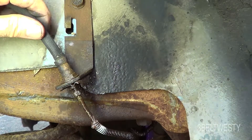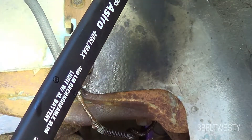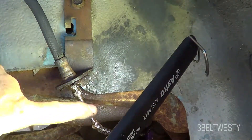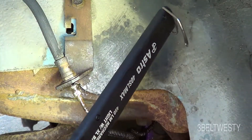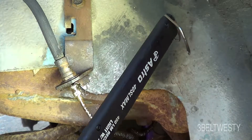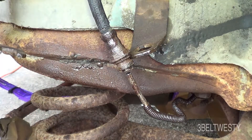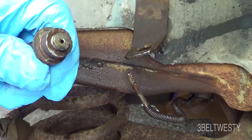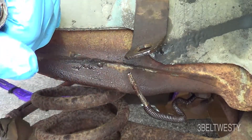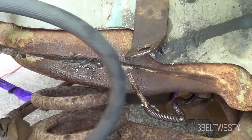I've been fooling with this last weekend and this weekend with no luck, so I've got one of these brake lines on order. This is the driver's side — the other one I got off. I'll loosen this up but this is just not going. This is the third gen Camaro 82 — I just got through cutting off the brake line here with a cutoff wheel. Messed around for a week trying to get this off — heated it up, froze the pipe, used Kroil — it's totally goofed up.